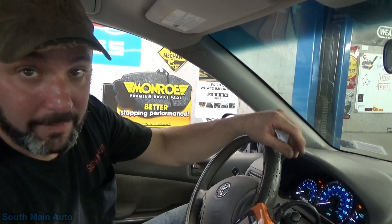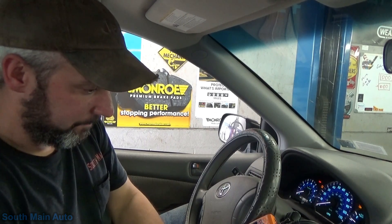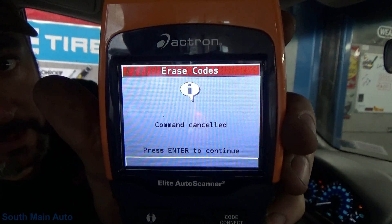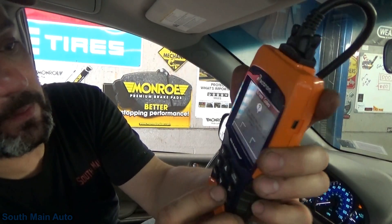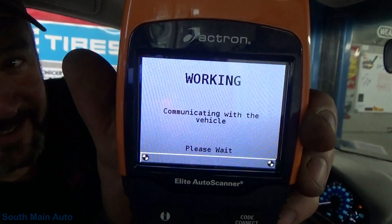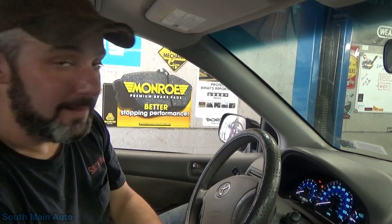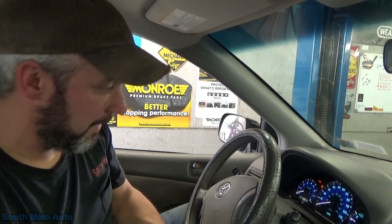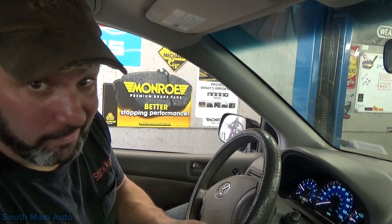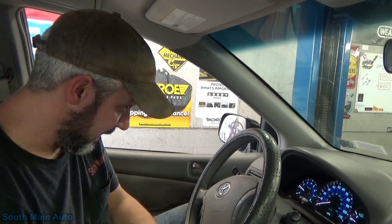We know we did a good job because we tested it — we confirmed the heater circuit on the vehicle was good, and we verified that the heater element in the AFR sensor was indeed open. We'll go in and erase codes. Command sent. We'll shut her down, give it a second, fire it up — and the light should stay off. Before, it would come back on instantaneously. We've got a blinking maintenance required light, but that's all — must be due for an oil change.